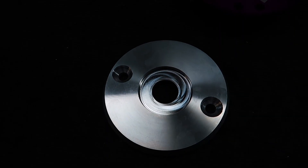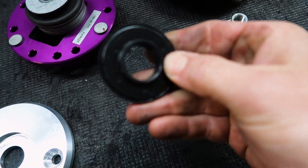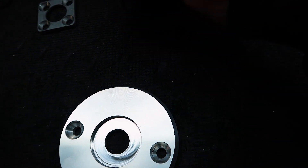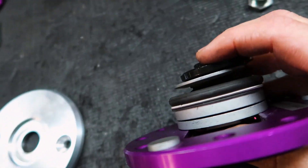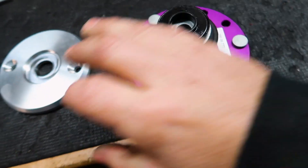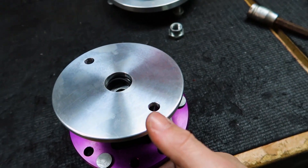When designing these mounts we have quite a few different options. We can either keep the original upper mount that came with the KWs, which gives camber adjustment but sacrifices drop. Or we can make a new upper strut mount which eliminates the camber adjustment but allows for more drop. We can make a plate with a pocket for the KW bearing unit to enable steering rotation — but the challenge is the entire stack-up from upper strut mount to the pillow ball and rotation bearing gets quite thick, roughly two inches of height.